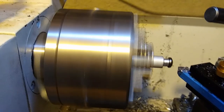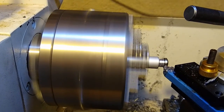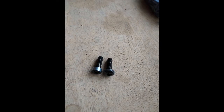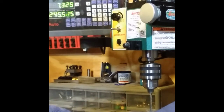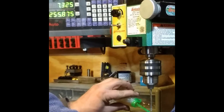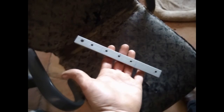I had to do this eight times for all the screws for that 3D printed bracket, ending up with eight screws with a slightly smaller head that now fit the bracket. Then I just had to drill a bunch of holes in the aluminum stock to a prescribed pattern to fit the 3D printed brackets. The holes had to be tapped — there are two different sizes: six holes, three of each size, for the battery leads, and one larger hole tapped for the power leads going into the e-panel.